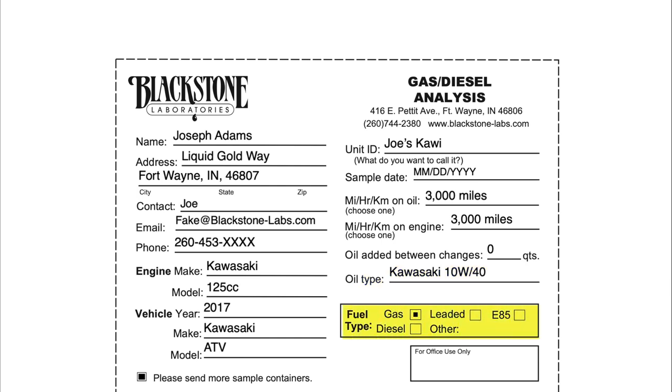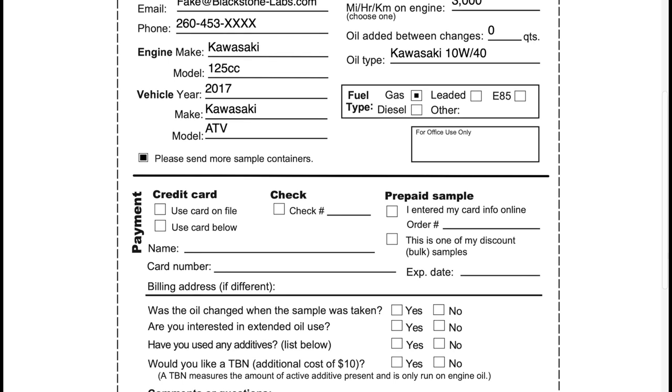Lastly on the front side we have fuel type — don't skip over this, especially if you are adding leaded fuel. Blow-by from leaded fuel can result in a high lead level in the used oil sample, so we want to know if any of the lead we find in the spectral exam might be from the fuel you're running. If there's an absence of any engine make, model, or vehicle year information, we can at least plug in some generic averages if we know this came from a gasoline or diesel engine.